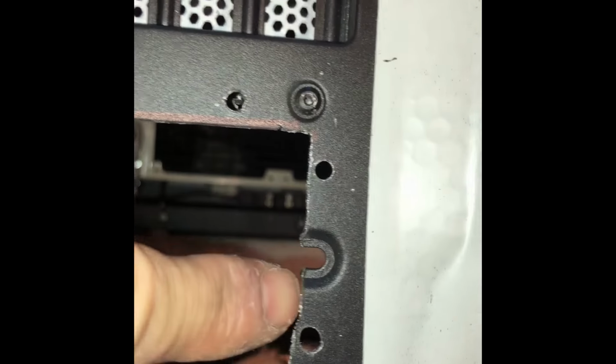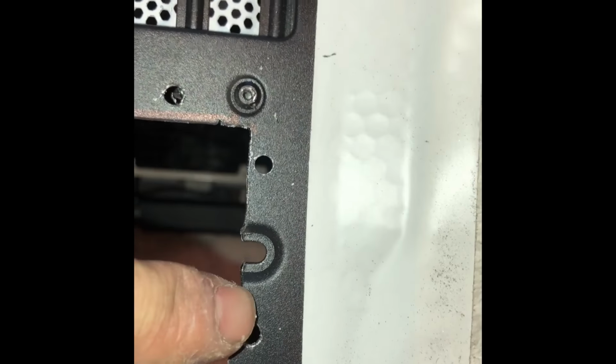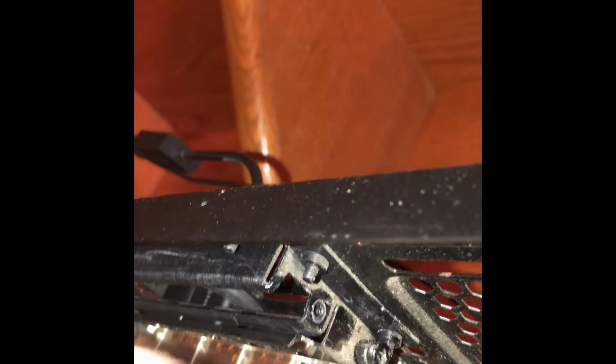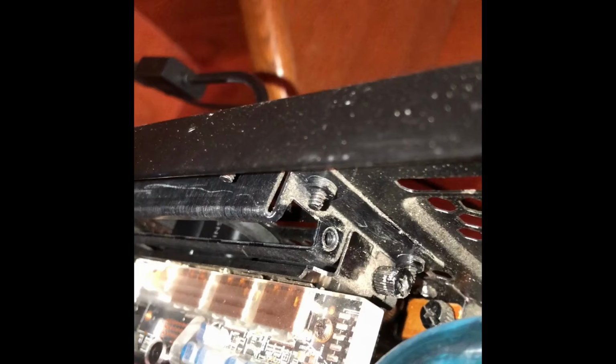And if you see that looks that way a little bit, that's on purpose. This has to be up some between these two holes for the video card tab to slide into. And what I mean by that is this. See that tab right there? The actual tab right here, see how it goes up almost and touches the bracket? Well, this bracket's mounted the opposite way, but when the bracket comes through like that one, the video card tab would hit the case before it went all the way in line with the holes. So what I did to fix that was I ground this higher right here.